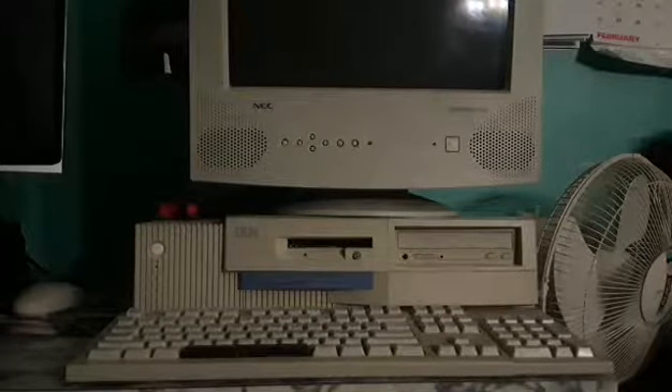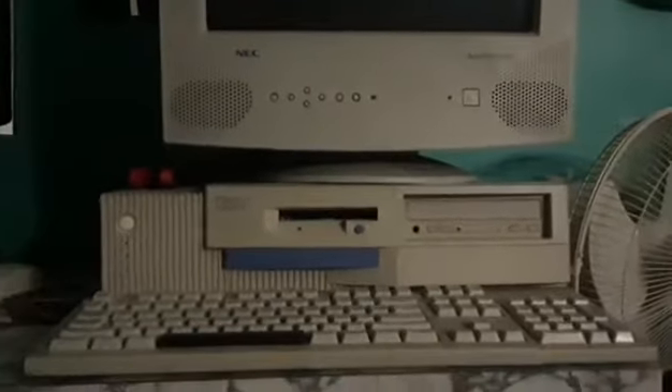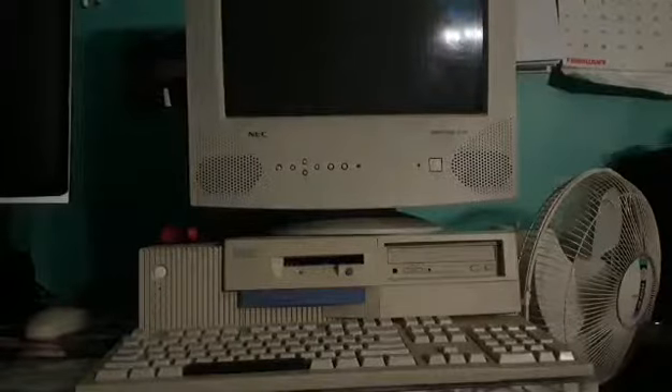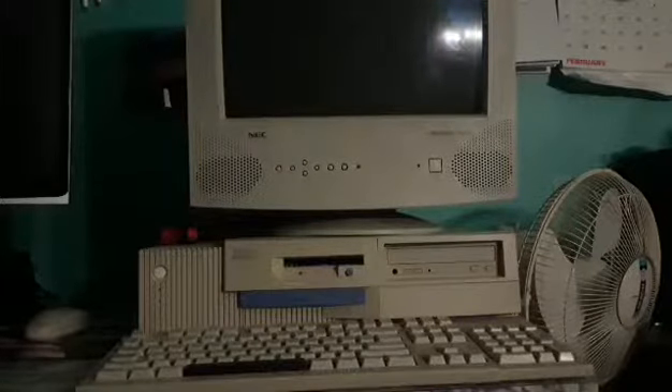I was very confused, very upset. I took out the RAM that was in there — which was an original stick of IBM and a stick of some memory savers or something — and replaced it with my own RAM, which I know works. That didn't help. Actually it did help a little bit — it displayed once. Then it just kept beeping. That's all it would do. It was beginning to make me very unhappy.